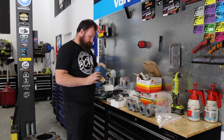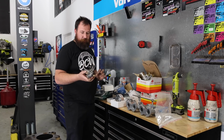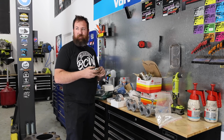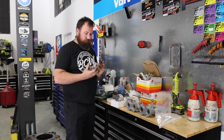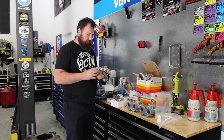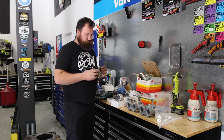And the very last thing that I got is another bit of a Marketplace find, which is just a mechanical type fuel pump that the carby guys specifically said to run, the factory style fuel pump. So this should pretty much bolt straight up to the head and it'll run off the cam, and means we can have pretty reliable fuel pressure.